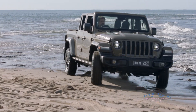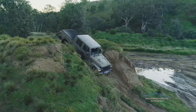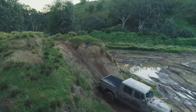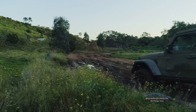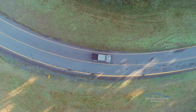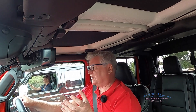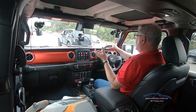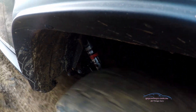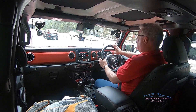I don't think I'd like to drive it with the roof and sides off — no thank you very much. The approach and departure angles really allow you to get out off-road, and the ground clearance means you can pick over rocks and so forth. Its off-road capabilities have never been in question. What's always been the problem is the way they drive on the road — these off-road tyres make the steering a little bit woolly. The sidewalls are so tall there's so much give, and if you took lower-profile tyres off-road, you'd come to grief the second you meet a sharp rock. The special dampers make the ride at 80 really, really good. There's quite a bit of hum from those tyres at 80, but notwithstanding that, ride is excellent.